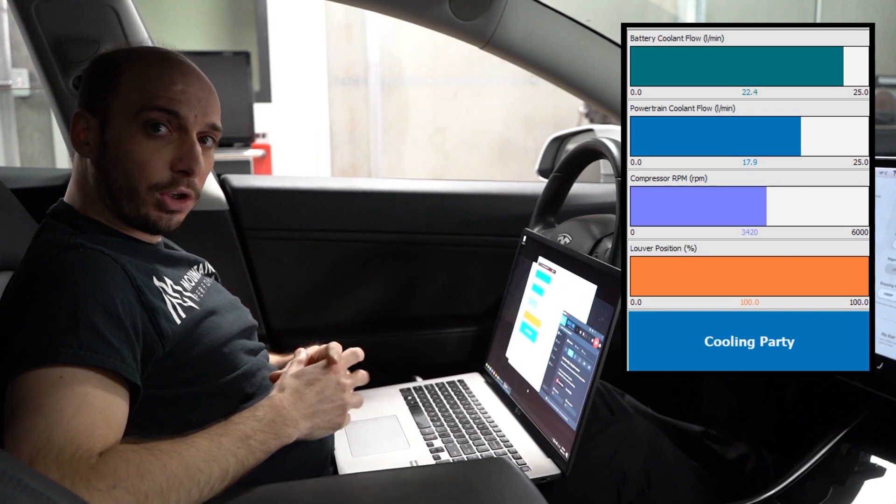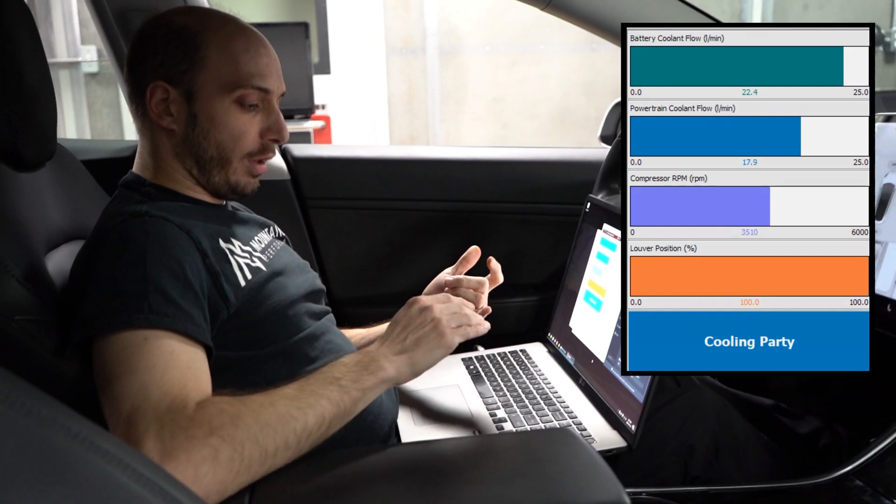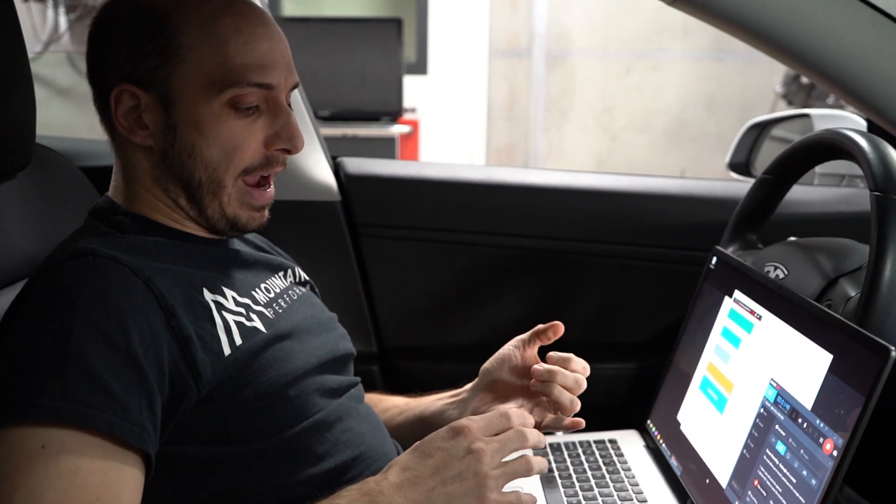The reason this is pretty cool is when you're at a supercharger, the car uses the motors to heat the oil, which gets very hot, then heats up the stator, and that heat transfers to the battery — the whole system gets heat-soaked. So even if you've got a 15-minute drive back to the track, that system is not going to cool down. And even if you want to use track mode on the way back, you're going to lose a fair bit of battery charge doing that. This box allows you to pre-cool while you're supercharging.